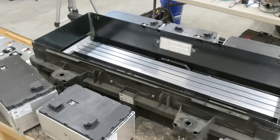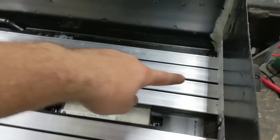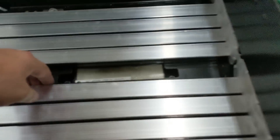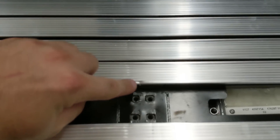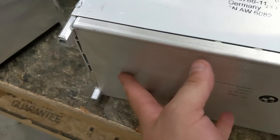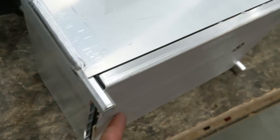We've now pulled out the modules from this case and inside is a really cool heat exchanger. We've got two coolant ports — one input, one output — and the coolant flows down in a U-shape over and then through the other side. These are thin-wall aluminum and look like they could dent pretty easily. I just can't believe the engineering that went into this.